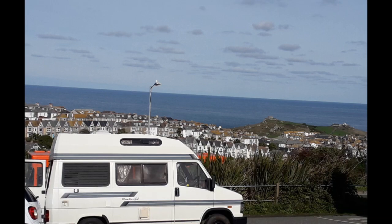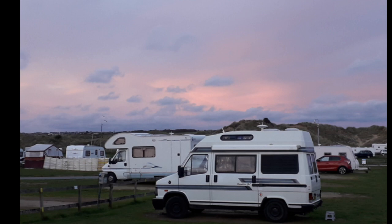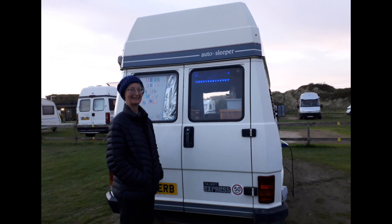So I decided to look at the linkage. To get at it easily in my particular motorhome - the Talbot Express - it's a matter of removing the spare wheel and the spare wheel metal carrier, which is basically two bolts. To make it even easier, I also removed the air filter and some of the air filter hoses, which gave me more access to the gear linkage from inside the engine compartment.